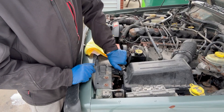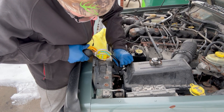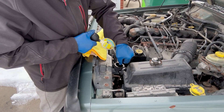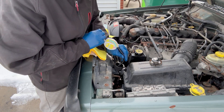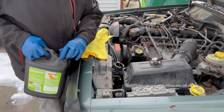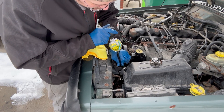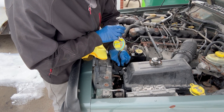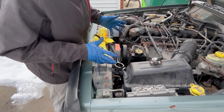Let's see where our coolant level's at — better. We either got a bad hydrometer or it's been so long since I've used it I can't remember how. I definitely need more fluid; I'll try it a little later. I'm likely going to have to bleed the system or burp it. The fluid is good to about negative 7°F, since I'm in Fahrenheit land.